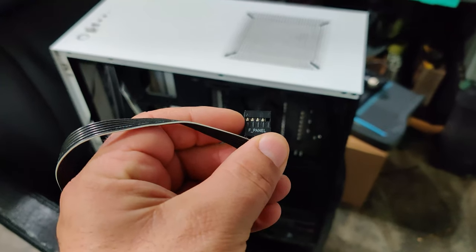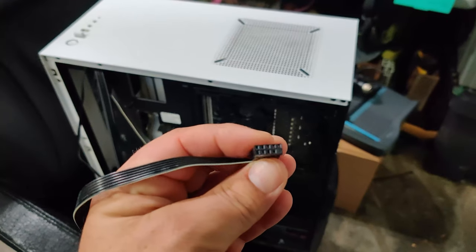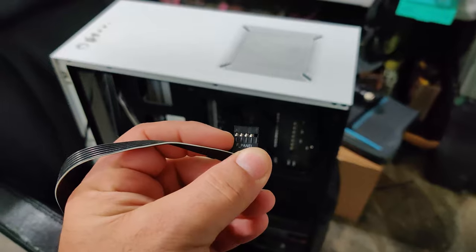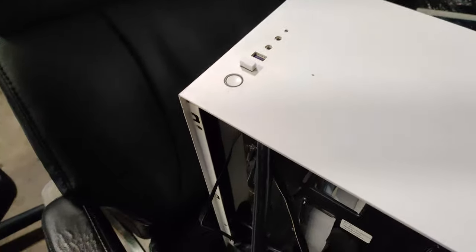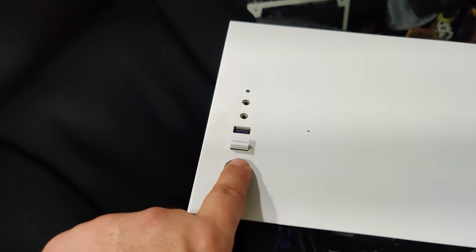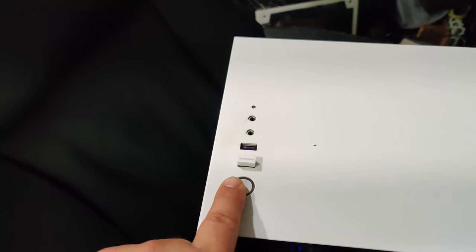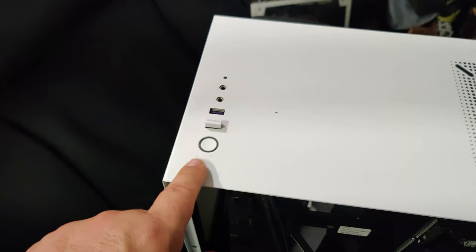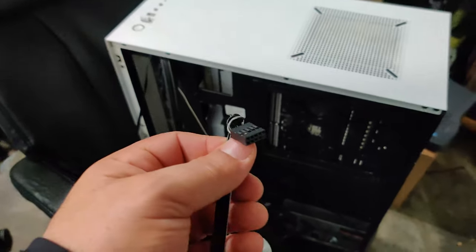You're going to want to start one in. Then after that's barely started, you're going to have to keep holding it. You're going to want to go and start the one catty corner from it. Then you're going to do this one, and then you're going to do that one in no particular order. But what you want to do is you want to keep constant, steady pressure. You don't want to just screw one end down first and then try to do the next one, because it's not going to work right, and you're going to end up screwing your processor up. So once you get them all barely in there, you're just going to start with one and keep going around until they're all nice and tight.